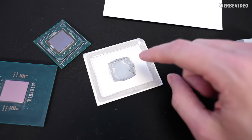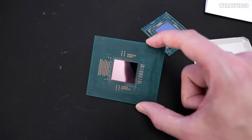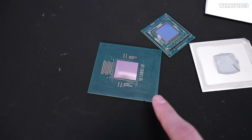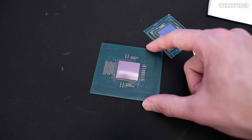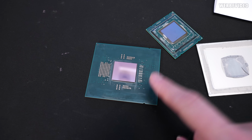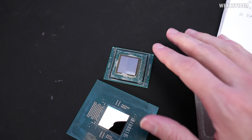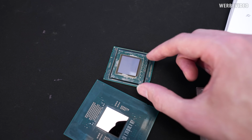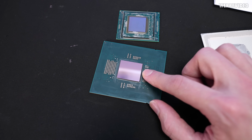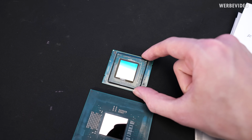You can see still the thermal paste residues on the IHS, while I already cleaned everything off the package of the CPU. It's quite impressive, especially when you measure the die sizes. It's about 22.5 times 25.5 millimeter in length and width, which then equals about 574 square millimeters of die size. Compared to a bit older 7980XE, this had about 480 square millimeters. The width is the same with 22.5, but it's about 4 millimeters longer. It's still somewhat comparable in die sizes, which is why I took this CPU for comparison.